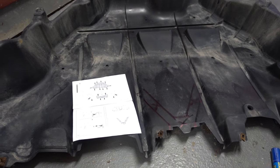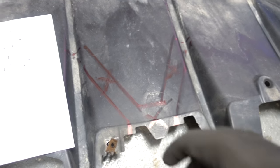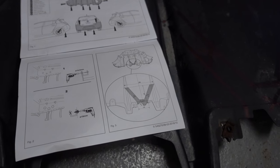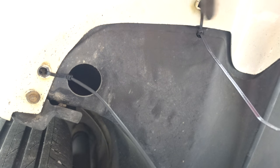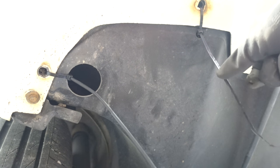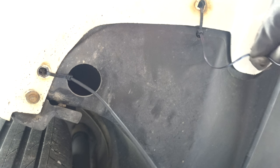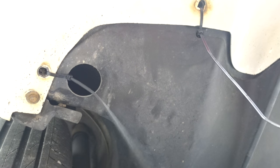In order to make the splash shield fit you have to do some modifications — you have to cut out a section, and it's all stated in the manual what to cut and how to measure. I got the splash shield back in but some of the clips and bolts were so rusty that I had to replace them with zip ties. That's a really good tip if you can't be bothered to source the correct replacement bolts, because you'd have to pay Nissan prices. Zip ties — they are your friends.